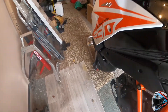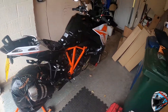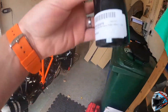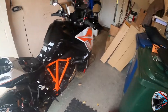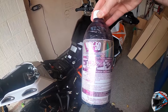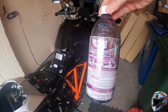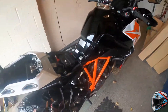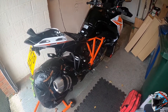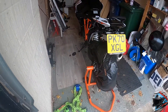Because with the ACF 50 you literally give it a liberal coating throughout. I use one of these atomizer sprays and I literally fill that with the ACF 50 — this product here. I'll fill the atomizer bottle and put it in a jug of boiling water for about five to ten minutes, just to take some of the viscosity off the oil so it goes on a lot easier and a lot finer when it's smooth.